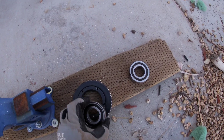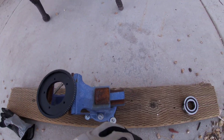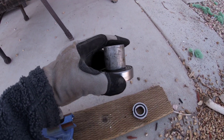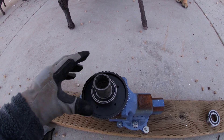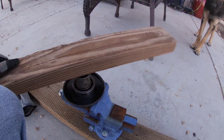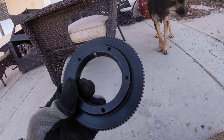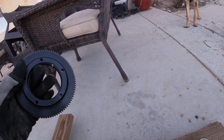The way I pulled the bearing out is I used this vise here — just simply flip it over. I happen to have this lug nut remover, it's 1 and 1/16 in size and it fits just perfectly in there. I just placed it like so and using a 2x4 wood, I just hammered it down and it popped out on the other side. Keep in mind it only goes out one way — there's a lip on one side, so you have to make sure to flip it around and hammer it going that direction.